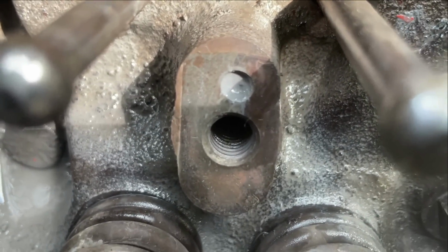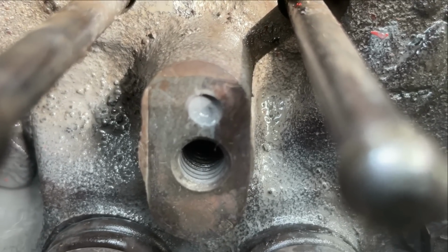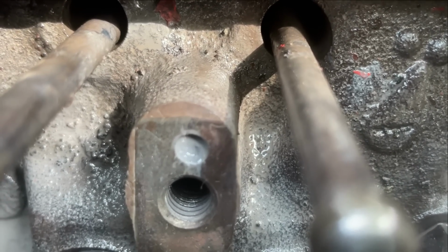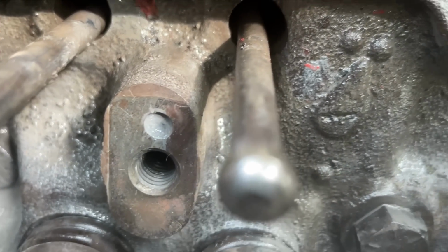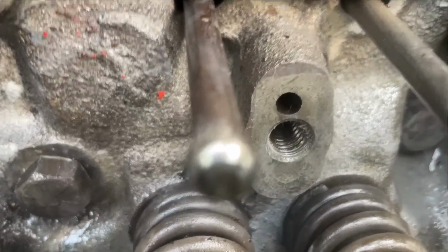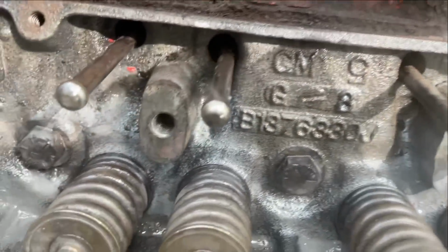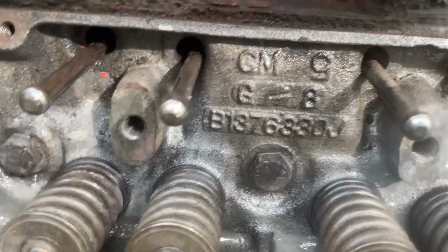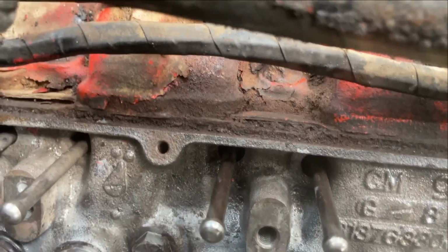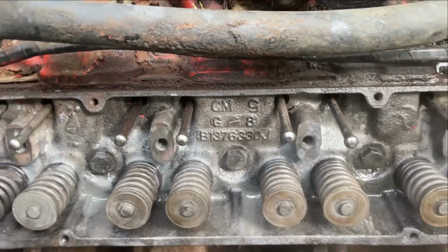See that small hole in the tower? That's where the oil pressure comes through. It obviously doesn't come through the bolt hole. That is plugged solid. I tried to stick a red tube down there from the brake clean. It is solid. It's supposed to look like this. So these middle 2 don't have that, so they're not getting pressure. It's just the front and the rear. I need to clear that up, and then I think the oil pressure problems to this rocker shaft will be solved.